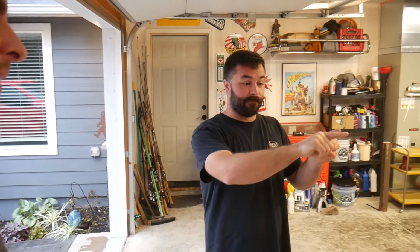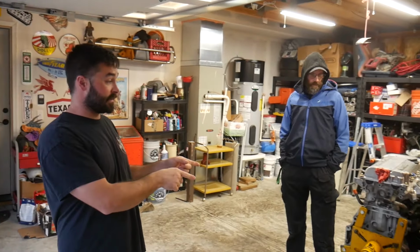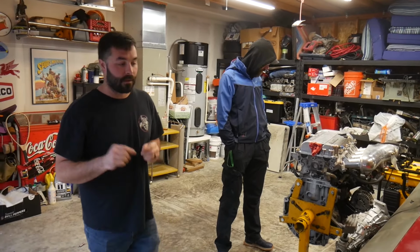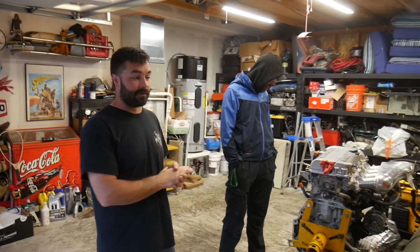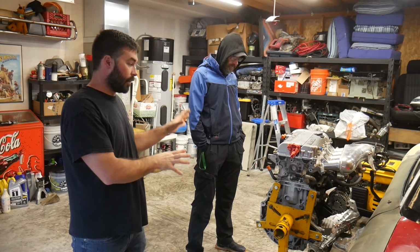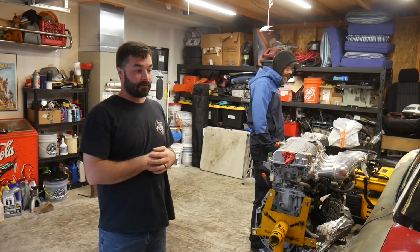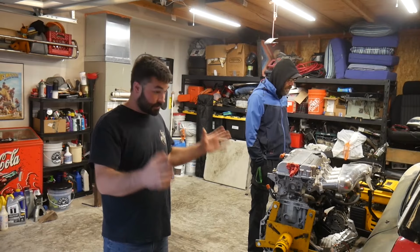What that's going to do is put 2 to 3 cylinders ahead of the power steering rack, which is going to put a ton of weight on the nose. And what I would like to do is keep this a lightweight track car with perfect balance. What I can tell you is that this SR20, in its current spec, is lighter than the rotary that came in this car. It will also make 100 more horsepower reliably with the piston engine. It's going to have a Link ECU and a really nice Wiring Specialties wiring harness. I'm going to take it to get it tuned at Drift Garage over in Auburn. And this should be a really nice, reliable car as long as I don't push it too much.